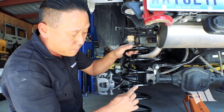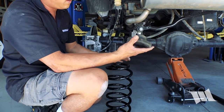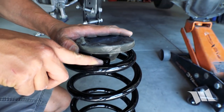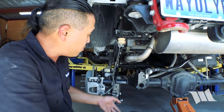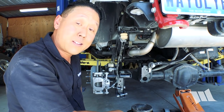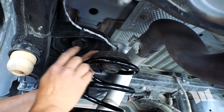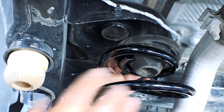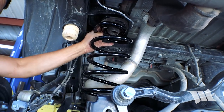There are part numbers on the springs, so there's a top and a bottom — we make sure the part number is legible. Then we grab our upper spring isolator, which is indexed, and ensure it is situated accordingly. Installing the rear coils is tricky because nothing holds them in place, so we have to do a dance of getting the coils in, raising the axle, and positioning everything until it's all situated. There's a little nub on top of the isolator and a corresponding hole in the upper perch — just like up front — so we rotate the coil so it goes into that hole once installed. We raise the jack a bit to hold the driver side in place, then repeat for the passenger side.